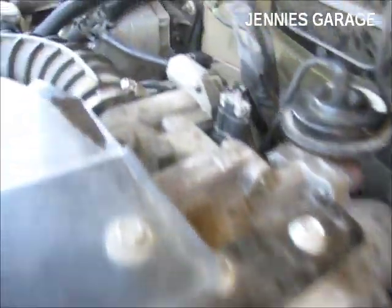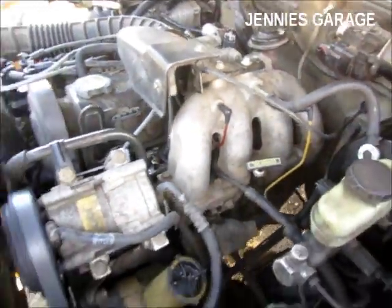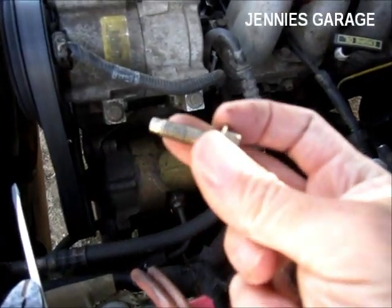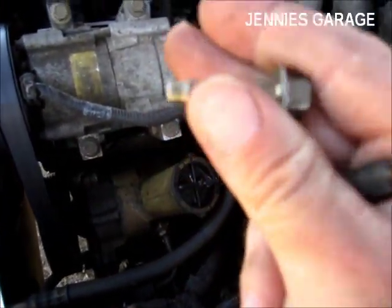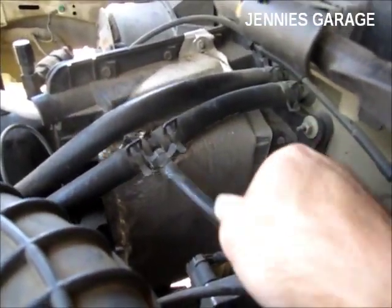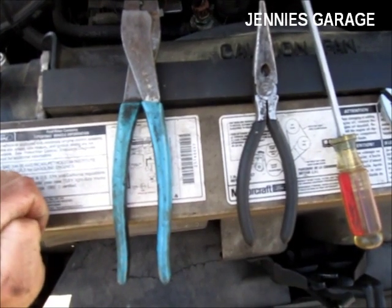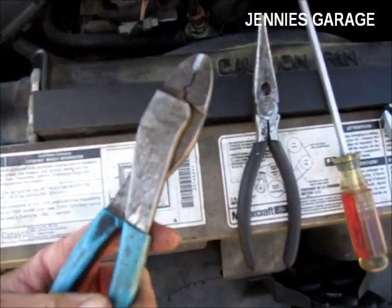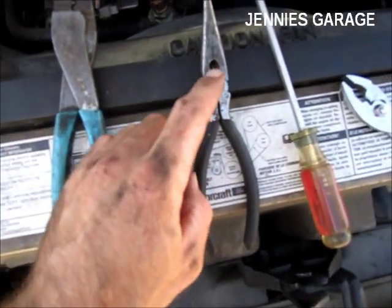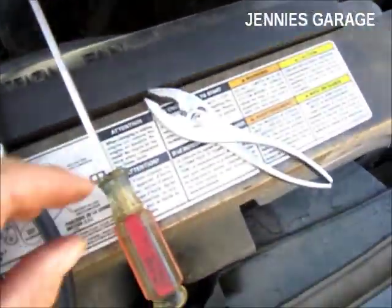So what I'm going to do is cap off both the inlet and the outlet of the intake manifold lines. To do this repair, I believe I'm going to need two bolts — the size just has to be such that they'll fit snugly in this small heater hose. I also need a hose clamp. The tools required are cutters capable of cutting heater hose, needle nose pliers, a long flat blade screwdriver, and pliers.